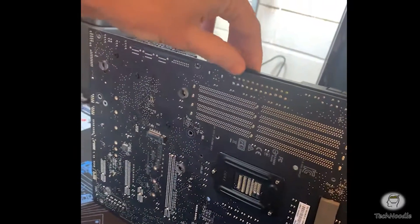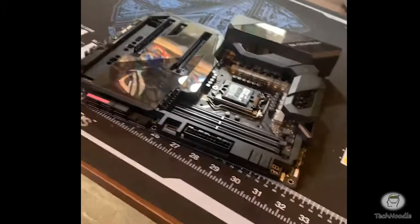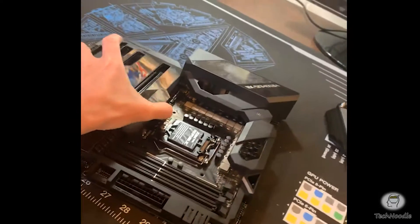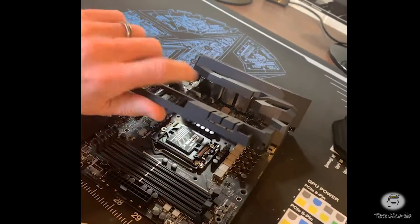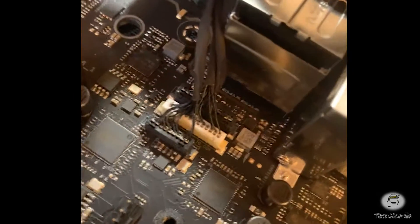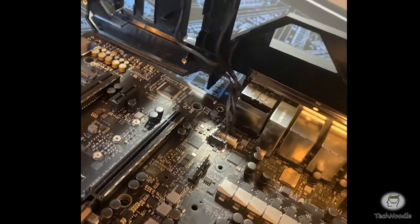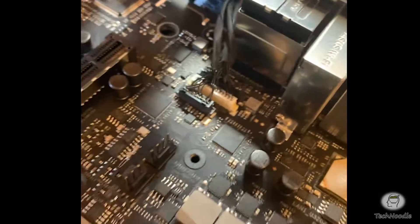Now, once those are off, you will be able to remove the outer housing on the top of the motherboard. No thermal pads here — this comes straight off. But there are all the LED cables down here with quite delicate plugs, so do be very careful pulling it off. Don't yank it. Don't apply much force to those — they are quite fragile plugs with tiny little wires.